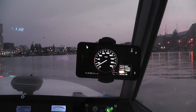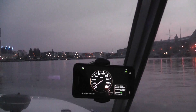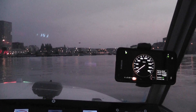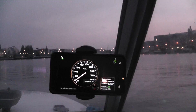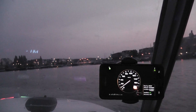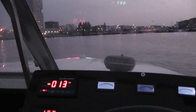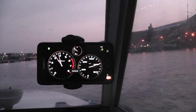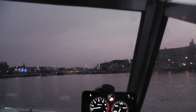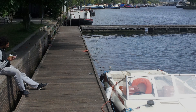I'm going to bring it down and turn off the blowers. This would be a nice city cruise — a little bit quiet. Eight kilometers an hour, just above the legal limit for the canals which is 7.5 — faster than walking, slower than a bike, as they say. Sitting at about 13 amps, which is 91 amps for the motor at 1,200 RPM. So I think we'll finish our evening cruise at these settings.